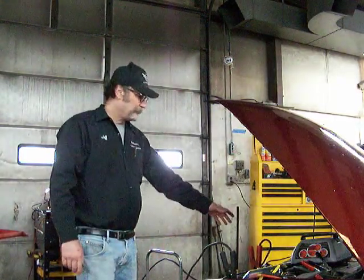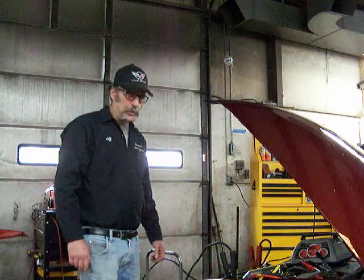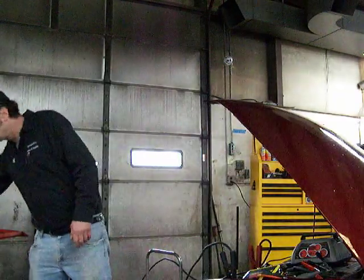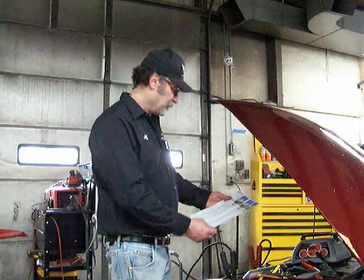The alternator, however, is not designed to fully charge your battery. It's designed to keep your battery charged. So leave it running while you're at the store. When you get back home, put it on a charger and charge it up properly. And again, I'll link one of these charge rate charts in the comment section.